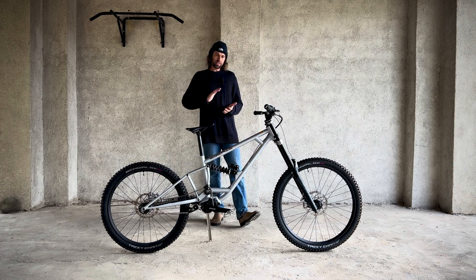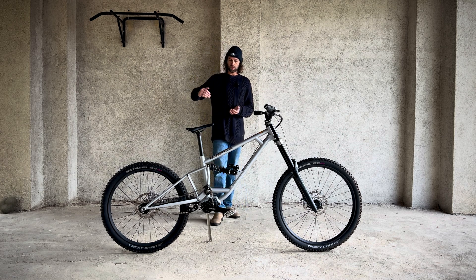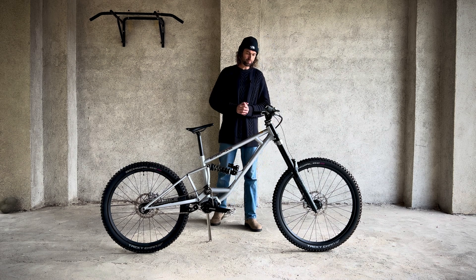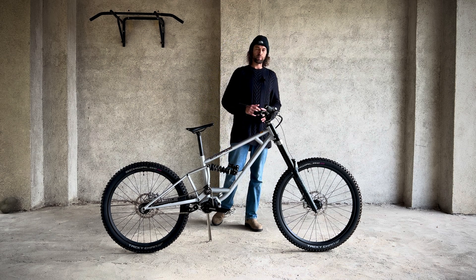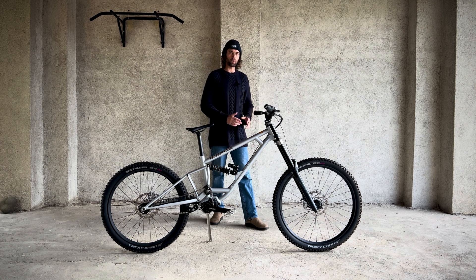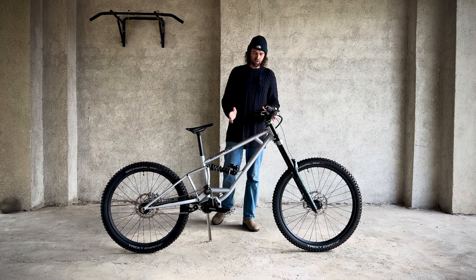While linear, if you have a really progressive bike, it's nice and soft at the start of the travel, but it really ramps up at the end and it's hard to use all of the travel. A lot of the time you're sitting in that mid-stroke, not getting the mid-stroke support you want when you want to push into corners or keep that rear wheel stuck to the ground. Think of a badly performing air fork — you're sitting in the middle of the travel, it's really soft, you've got nothing to push against. Everyone knows a coil fork feels the best because it's linear. Every mountain bike company for years has been trying to make their front suspension fork more linear because it feels like a coil. This bike is coil front and rear — it's got a similar leverage ratio front and rear, essentially.